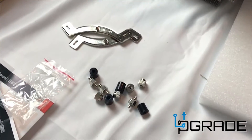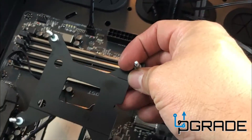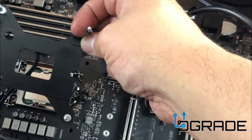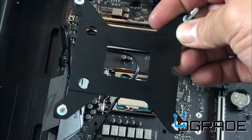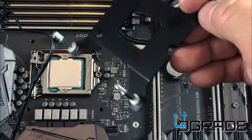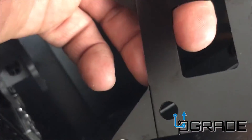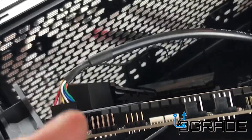There's a problem with the radiator installation. It seems like the backplate needs to go right underneath the motherboard, which causes a lot of issues — I have to unscrew everything, put this backplate underneath, and secure it through the bottom. So we're going to have to take a step back. This part has to go underneath the motherboard, and I included this as part 3 because usually the motherboard has the pins set up already, but in this case it doesn't. We're going to have to take off the motherboard and install it from the bottom up.